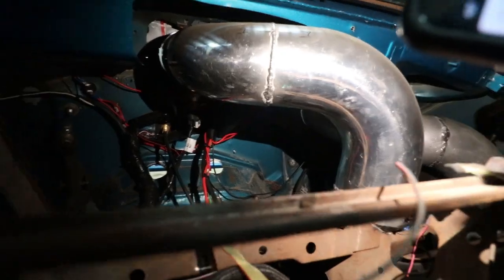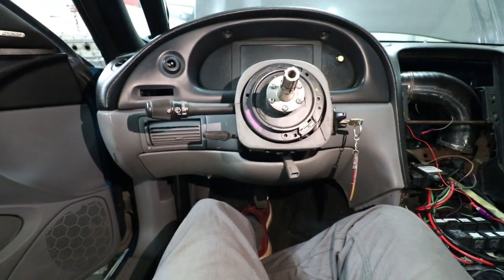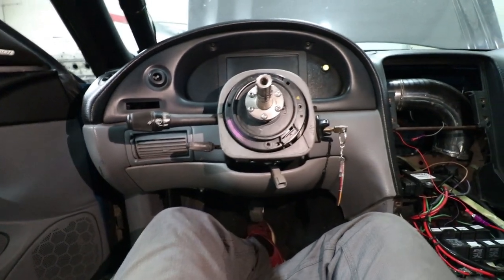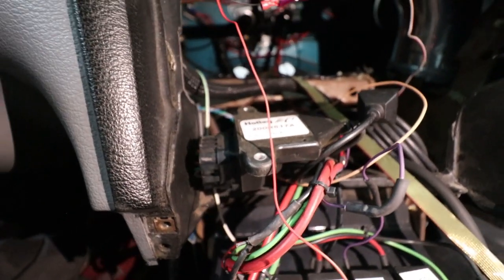Some booger welds a little bit. The steering wheel I also notice is not straight — it's off to the left a little bit, so maybe we can unbolt that and twist it sideways a little. But I did notice we have this Holley piece here — this actually lets you data log through the dash, which is pretty neat. I don't know if there's a solid state relay in this for the bump box as well, which I'm going to have to wire up, because bumping in under full power is the cat's ass.